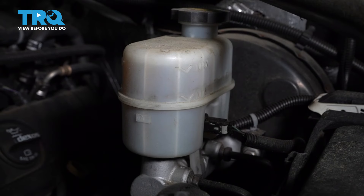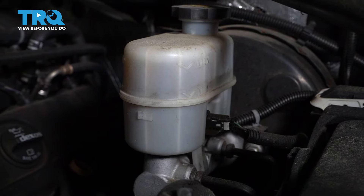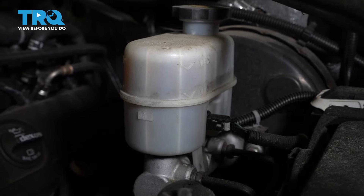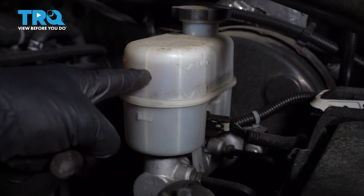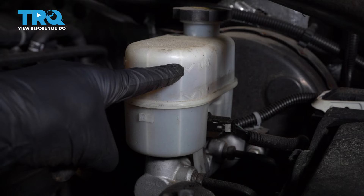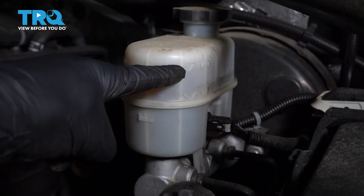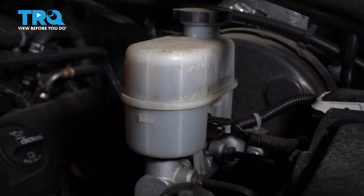Now that we have both sides done and the wheel is back on the ground, let's go ahead and torque each of these lug nuts to 140 foot-pounds. Now that we have all the wheels torqued, let's continue on by pumping up our brake pedal until it's nice and firm. Once you've done that, make your way under the hood to the master cylinder. You want to double-check to make sure it's topped off with DOT 3 brake fluid — you can see the maximum line. If it's low, bring it right up to that maximum. Close it off, close the hood, take it for a road test. Thanks for watching.